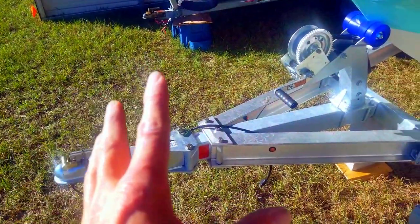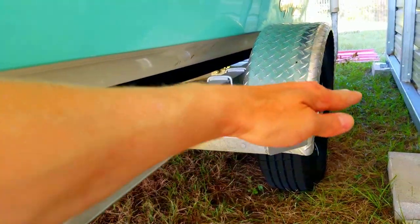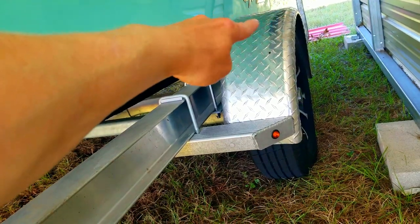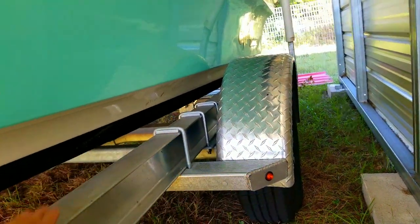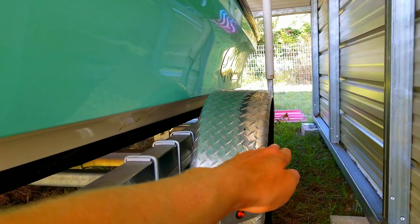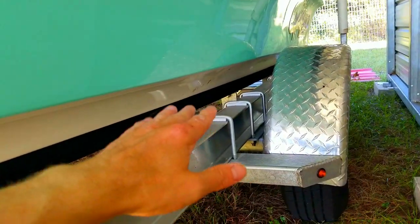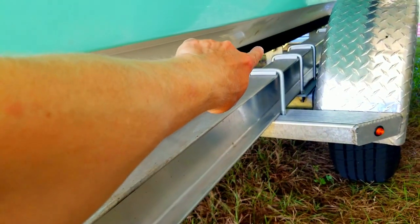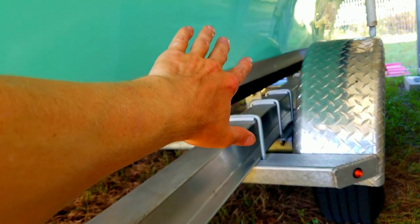The boat trailers very well — it drives up on the trailer extremely well. When you back the trailer into the water, you do not want to submerge the top of the tire well. If the back end of the boat floats, it's not going to trailer well. For me, I put the waterline about halfway up the tire and it trailers really well. Make sure the trailer is enough in the water so the boat touches the bumpers, but keep that back end from floating.